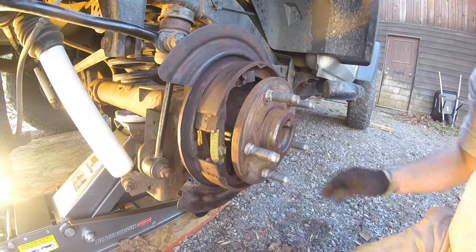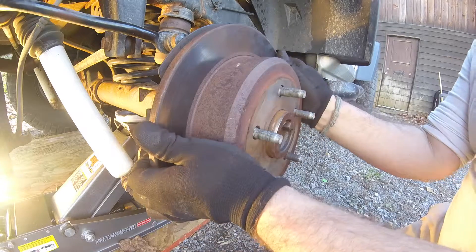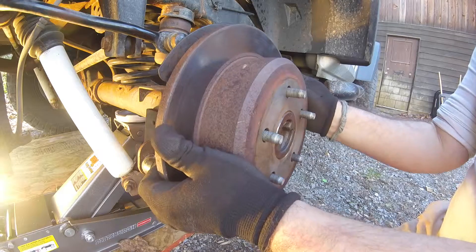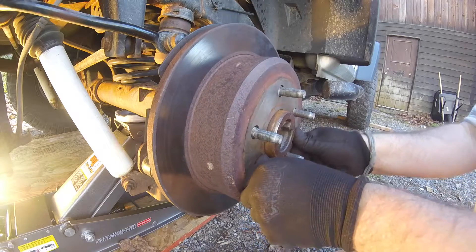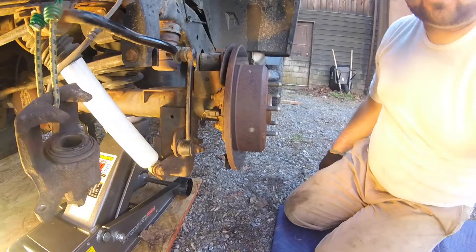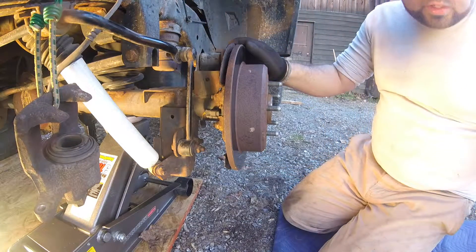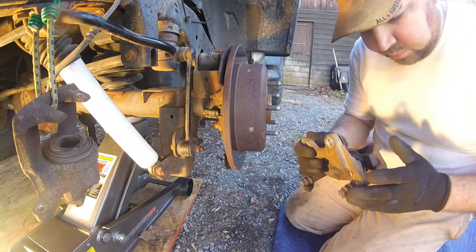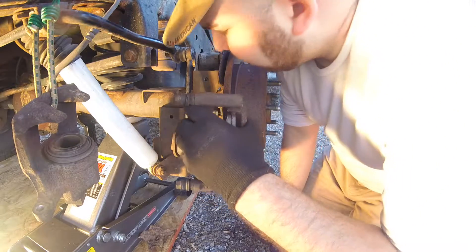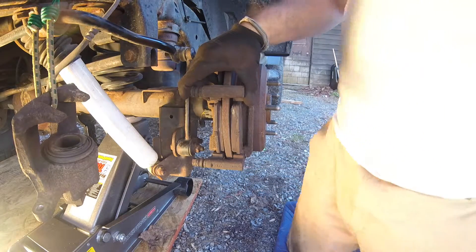Move that into place. There's some tension there. That's done. I've added tension and put the screw in — that's in. Now it's going to be time for putting the calipers back on — the brake pads and the calipers. I'm just checking the brake pads while I'm at it and they look good. They were recently replaced, at least last year, so they should be pretty good. I don't see any major wear on them. Got the bolts on.